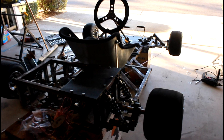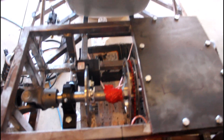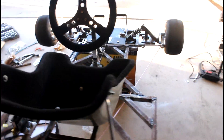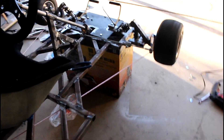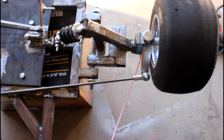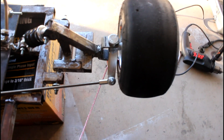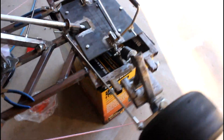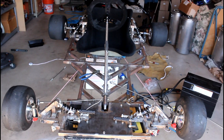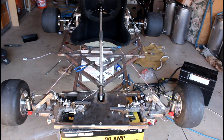I got the strings set up again to mount to the rear center point on the axle, using duct tape to hold the string down. As you can see, the angle isn't nearly as great as when it was mounted to the tires — before it was way over here, so I don't have as much modification to do. Looking from the front, those two strings go directly back to the center point on the go-kart, providing the proper Ackerman angle for the steering.